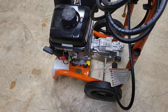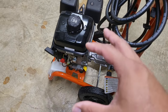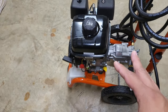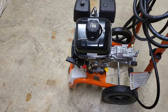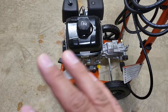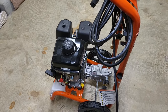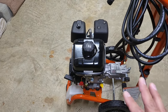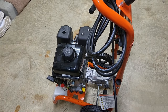The other thing — most small engines like lawn mowers and generators typically recommend you change your oil at least in the first five to eight hours of use. I'm at that point now — about three weeks in, used it about six times, roughly four hours of use. After my next use I'm going to go ahead and change the oil. After that initial change, you should change your oil at least once a year or once a season, assuming you're a residential owner and not using it commercially or very heavily.